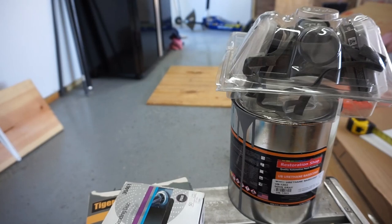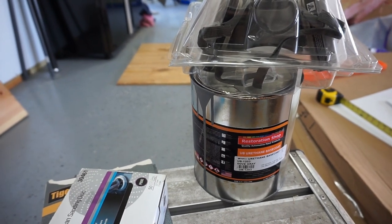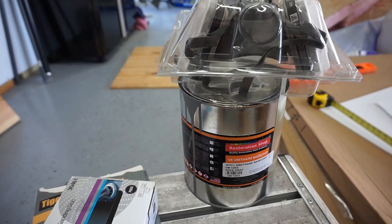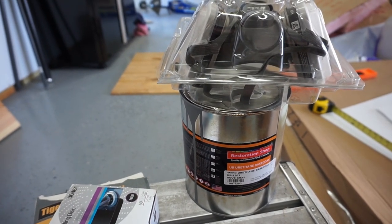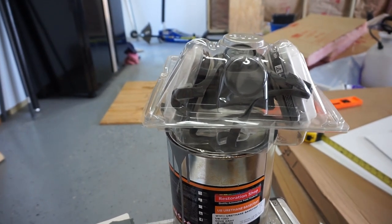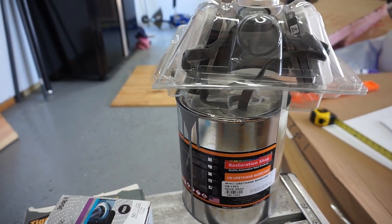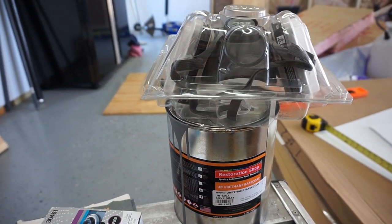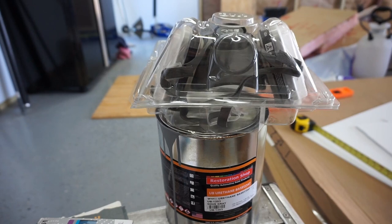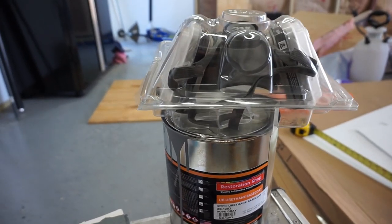We sprayed three coats of base coat around the whole car to make sure we got even coverage. I went quick and dirty on this — usually I would have sanded it down one more time to flatten it out, but I decided not to. Went over it with a tack cloth, which worked out nicely. Not as smooth as I would have liked, but we're going cheap and dirty. All in, I already had most of the equipment — everything other than the paint. We had to buy a couple more cups for the PPS system. All in we're definitely well under $400 on this paint job, not counting time.